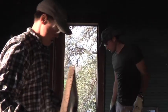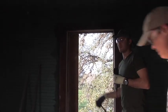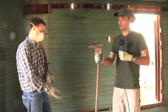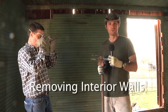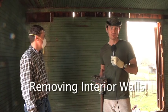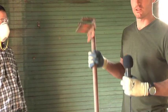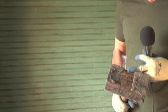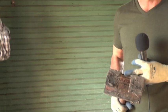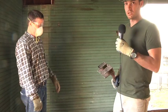Typically goes a lot smoother than that, but we have some hidden nails keeping that sash from coming out. What we're getting ready to do here is use our three-and-a-half-inch floor or wall tool. We'll be using it for the half-inch beadboard this time. We've got two pieces of angle iron welded together with a shaft and a handle on it, and this groove is cut out to go — in this application — around the wall stud. I'm going to hand this off to Virgil and he's going to show you the tool in use. This is his first day using it and you'll see how efficient he becomes.